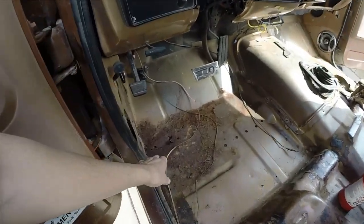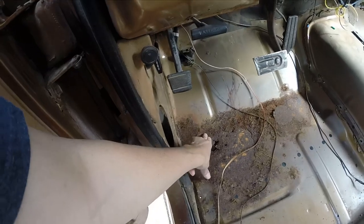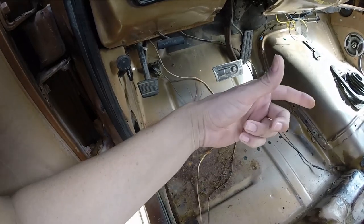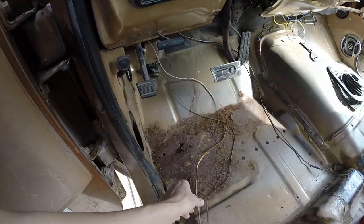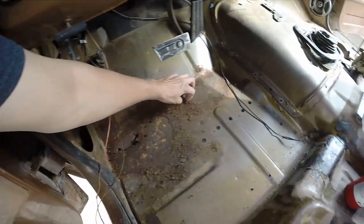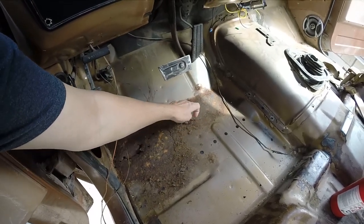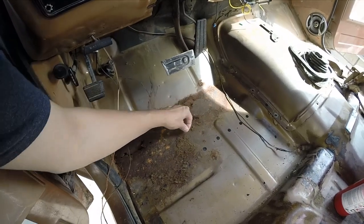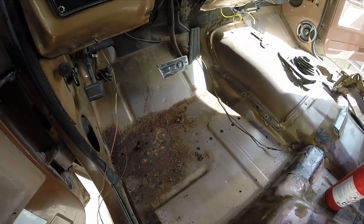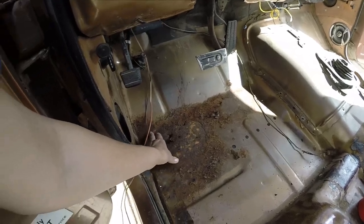The main issue is over here - we got this hole in the floor. I'm gonna have to cut a little bit out so I can put my patch panel in. I had bought a piece of sheet metal up at Lowe's that I was gonna use for my fender wells - gonna cut some sections out and try my hand at fixing it. Now that it's daylight we can peel some of this stuff up. Let me get back a little bit and let's clean this up and figure on a plan for fixing the floor.